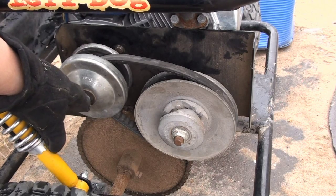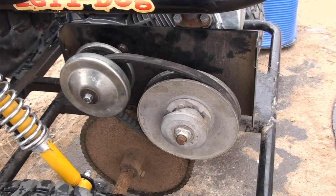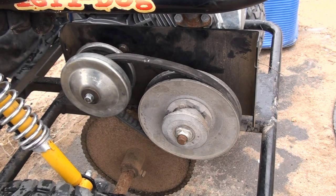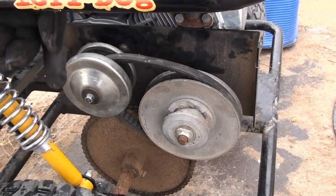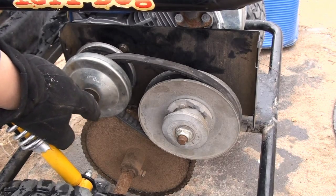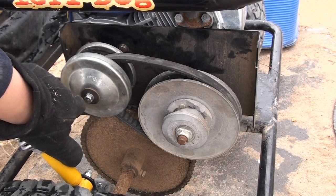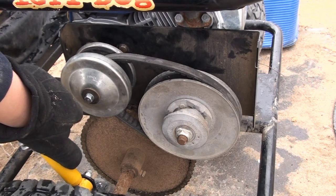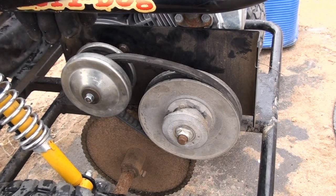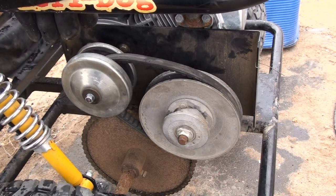Yeah, so I can fit and hold the torque converter down. If you're doing a swap on one of these or any other go-kart, you always want to make sure your torque converter is going to fit with the existing bolts from your existing engine. If they don't, you'll have to go out and purchase them at pretty much any home improvement store. You can find all that stuff that you need. But all I gotta do now is hook up the torque converter shield and do something with the throttle linkage. See how I can set that up and she'll be ready to run.